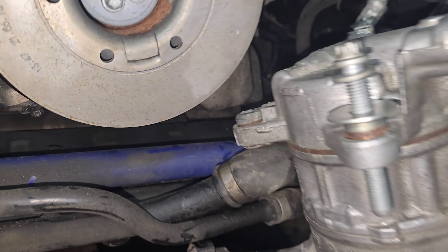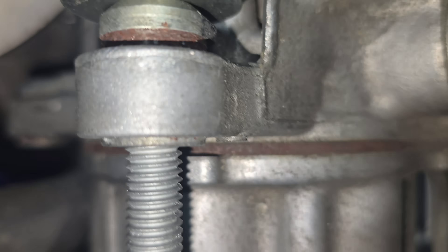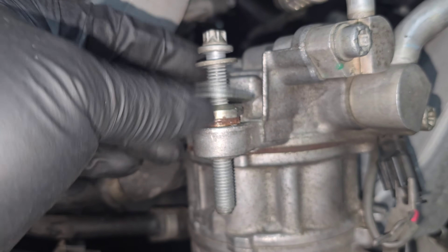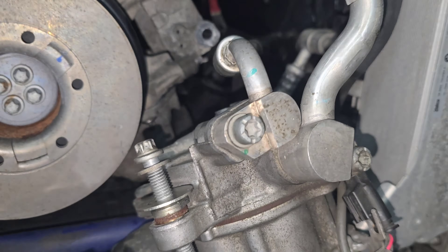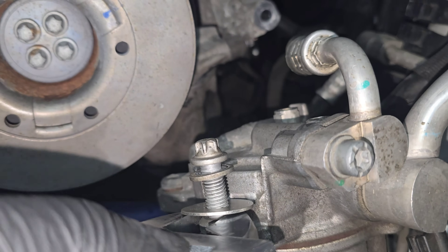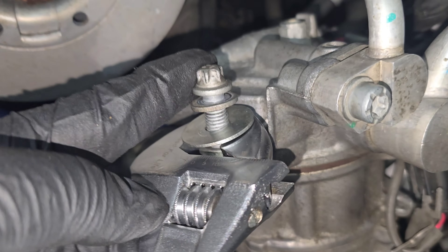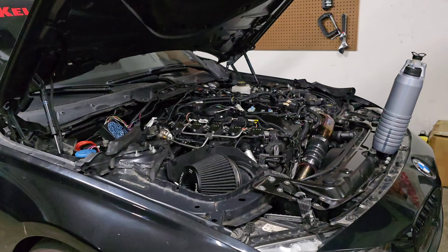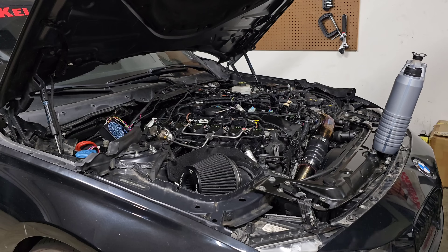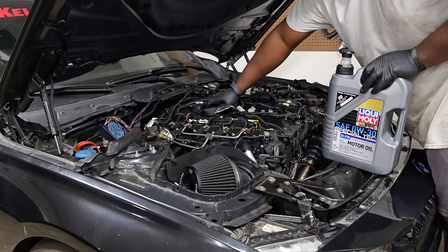Something I had to learn is that seating the AC compressor is almost impossible. I got some insight from Steven over at Wedge Performance and found that it's because of the bushings on the ears of the AC compressor. What you need to do is push them back out to create extra clearance. The way I did that is I used one of the bolts with a big washer and tightened it down onto something a little bit taller than the bushing itself — so being a little bit thicker, I could tighten that bolt and that would pull it out using the counter-hold method. It wasn't intuitive until I realized the bushings can actually move inside of those mounting ears. Then bolt everything back up, bolt up your transmission, your drive shaft, everything to get it fully reseated. Reinstall all of your radiators, your shrouds, your ducting, all that stuff.